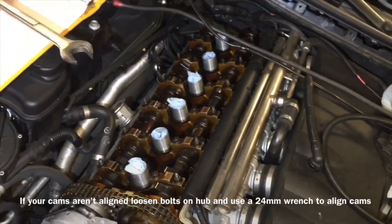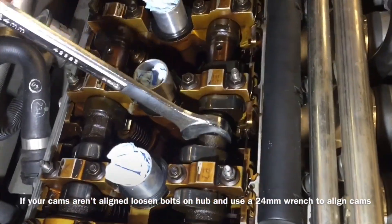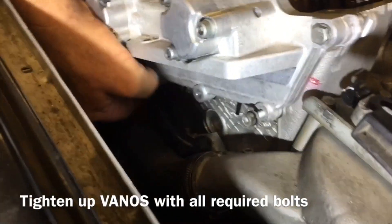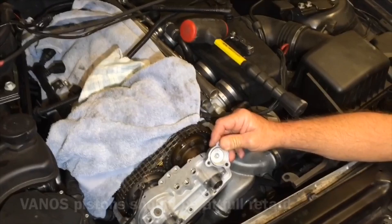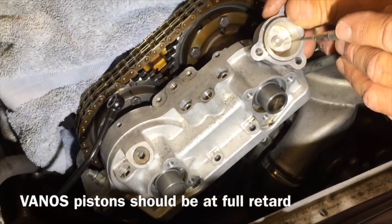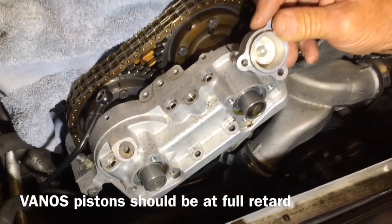We happened to get perfect timing on this one, but in the situation that you don't — say you have one cam off — loosen up that cam's hub bolts and take a 24 millimeter wrench on the cam itself and adjust it in the direction you need. Then tighten the hub bolts back up and redo your timing. Now that you're all timed up, we're going to finish putting all the bolts in the Vanos — three bolts down there — go ahead and put them in nice and tight. When setting the timing gears on the Vanos, these pistons are supposed to be in full retard right here, all the way out against the stop. I wanted to double check they hadn't moved when I pushed everything together. I pull the caps off and confirmed the pistons are fully back against the Vanos stops — right where they're at. We're in good shape. This engine's in perfect time.